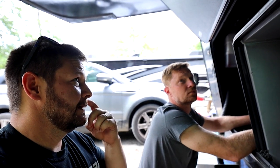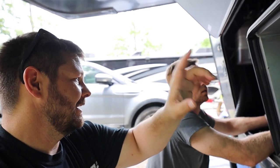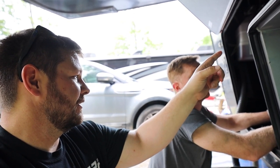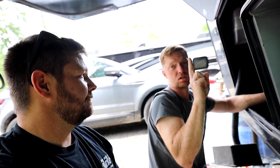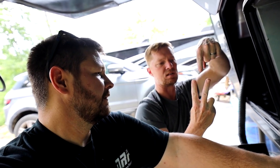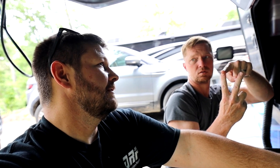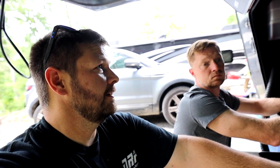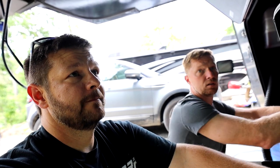So what you explained to me is that the inverter is actually pulling power from shore power when it's plugged in and passing that power through to the refrigerator, so the refrigerator is running on the inverter all the time. When the shore power comes in, it has a switch — you get power from the inverter side or from shore power. Inside the inverter, it switches between the two depending on demand. If you don't need the inverter, it switches to shore. And once we're unplugged from the pedestal, it should run on the inverter coming from the battery. Internally, the inverter should switch over to the inverter side coming off the battery to power the fridge.